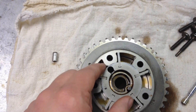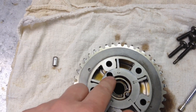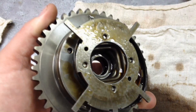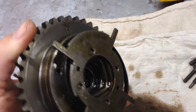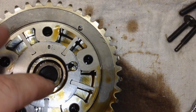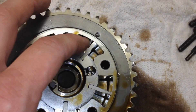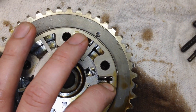Once it moves to advance or retard the timing, this pin lifts off to allow that. In the meantime, at hot idle it's sitting there with no thick oil around it to quiet it — it's oscillating and it's going to make noise unless there's a precise fit. I don't recommend taking yours apart unless you're very careful, as there's a big spring in here that'll snap your finger pretty good. Now I've got the vanes moving — there's a little detent here and a thin metal plate to quiet the noise from beating against the housing.